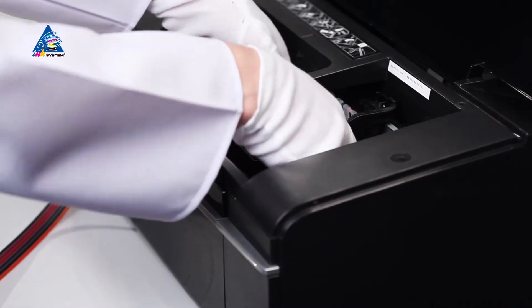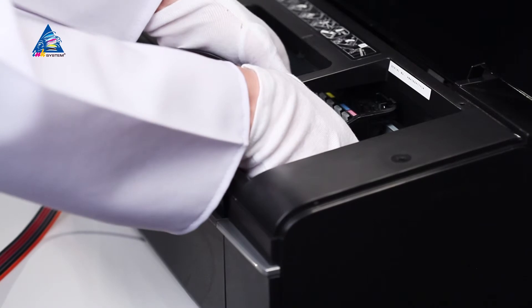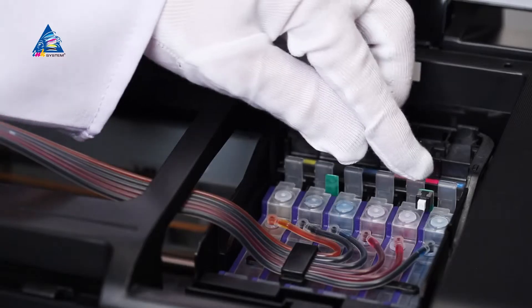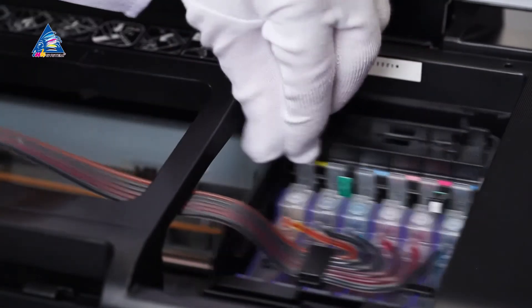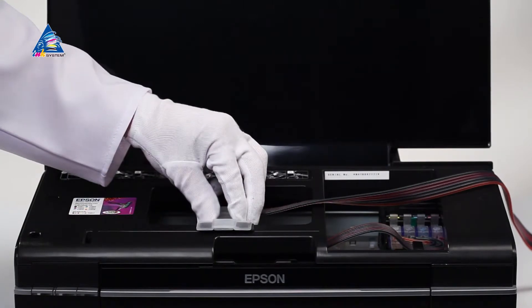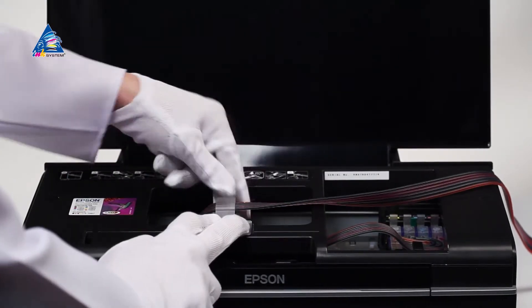Place the carriage onto the bar so that you can hold it with both hands and carefully push the cartridges down until they click in. Check all the latches and move the carriage to the extreme right position. Place the T-bracket and fix the ink pipe in it.